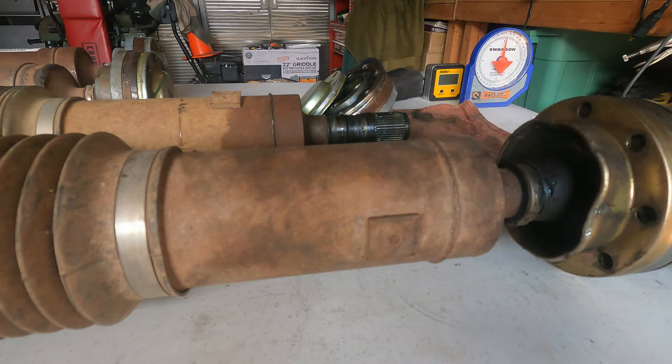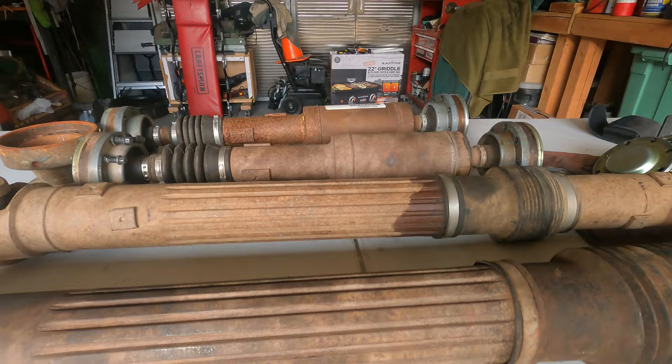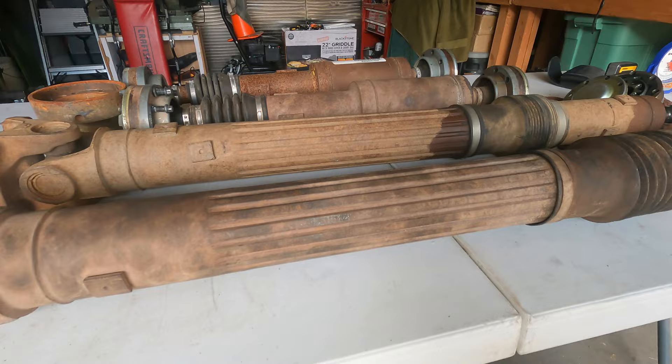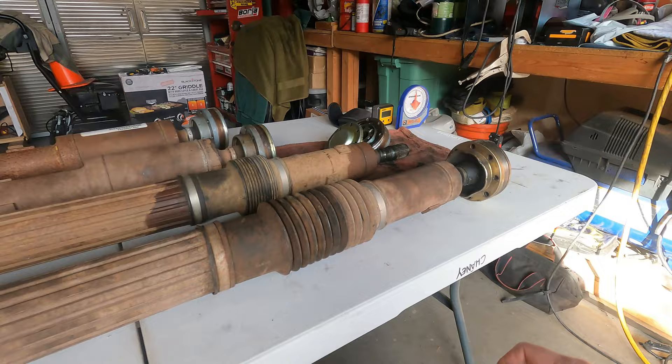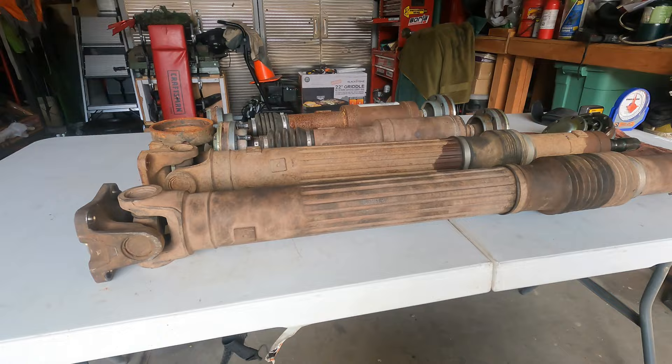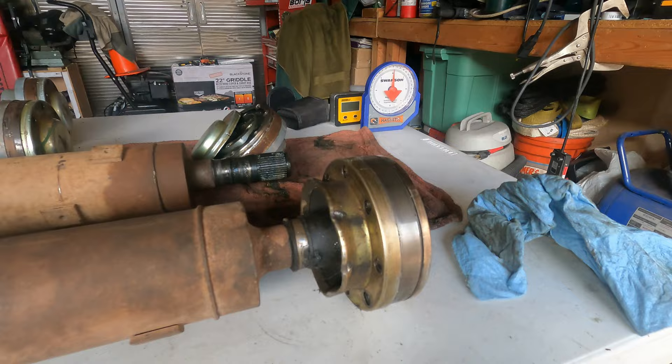The overall wall thickness of this drive shaft really isn't all that thick, but aside from taking a solid hit to the side of this drive shaft, they're actually not that bad for what they are. If you have a factory Jeep, this is not a bad drive shaft to have. As I recall, the lift limit for these sorts of joints is like three inches, above which you start having to make some modifications to your Jeep.